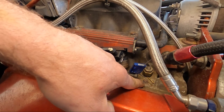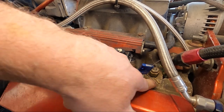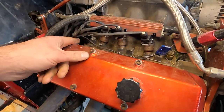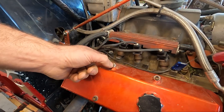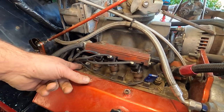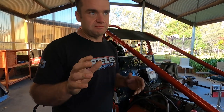To get that done and get the seals fitted, you need a couple of holes drilled in your inlet manifold. You can see this is my seal here — the AWSR seal. Make sure they're drilled and ready to go so when they come along and seal it they can just run the wires through and seal it. You also need holes so you can seal your rocker covers to each side — corresponding bolts each side from the inlet manifold to the rocker cover. That's so when you win an Australian title they can seal your engine to get pulled down and inspected at a later date. They will check that at daylighting — you won't get pinged for it but they will tell you to go and drill those bolts.